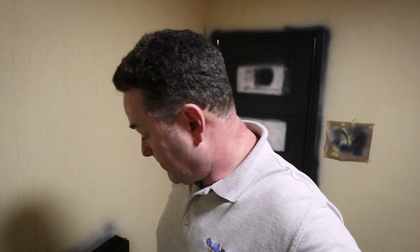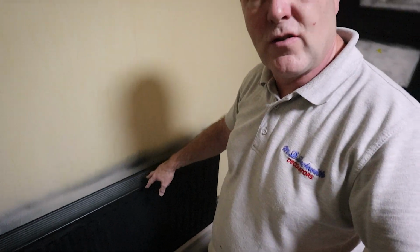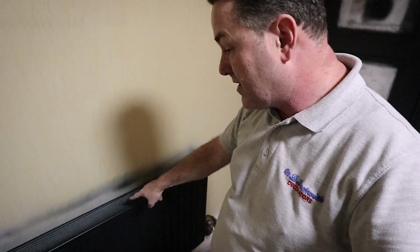Blinking heck, it's dark, isn't it? It's black. Right, radiator. The radiator I'm quite liking. If you can just see on certain angles, I've got to get those fins sorted. But once that starts drying off, I'll go with a very narrow fan pattern off that HVLP gun and try and get the areas that I can't get when I'm doing my main sweeps, because there's only so much time you want to spend in one spot without it gathering up too much paint.